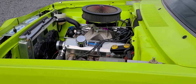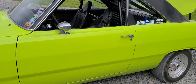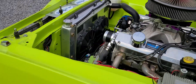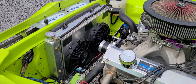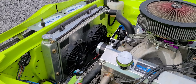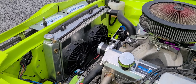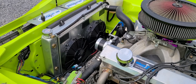This car makes probably a little over 600 horsepower — maybe 620, 630. Runs 10.20s. Might dip into the nines this year with some other upgrades and changes I've made. Just a big thanks to Griffin Radiators — super happy with this thing. I've never been able to keep this car under 220, but without the fan on I was able to keep it below 200, and then flick the fan on — boom — 160, 165 degrees. It cooled it right back down. We'll give you some more updates when we get into the track.